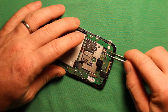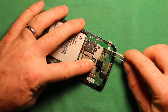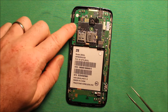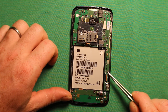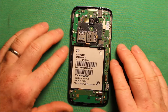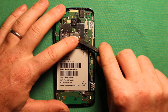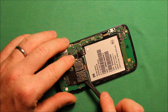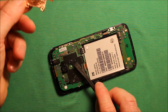It has one up here as well — the brown part needs to flip up and then that can go out sideways. There is a black screw here and a black screw here; keep them separate from the other screws because they are a different size. Then remove the connector for the SIM card and memory card tray, get under it and wiggle it up — it has adhesive under it and then that comes off.